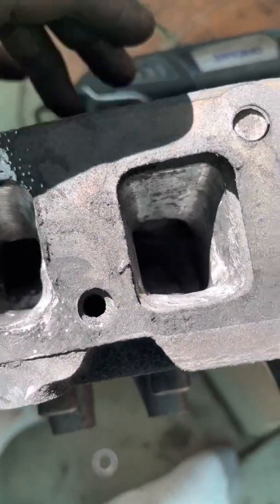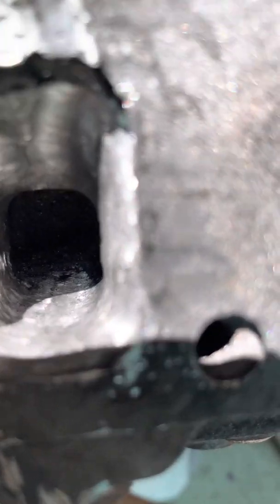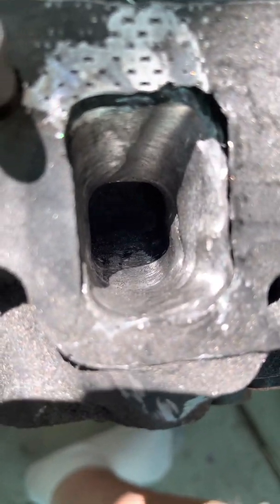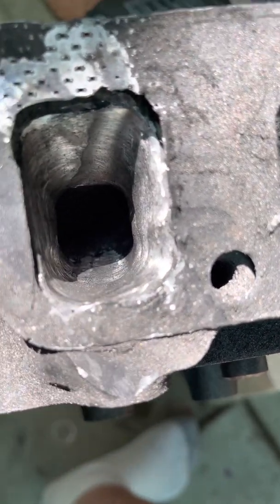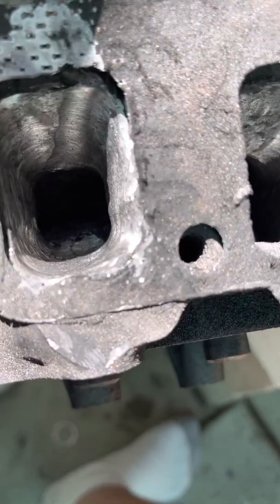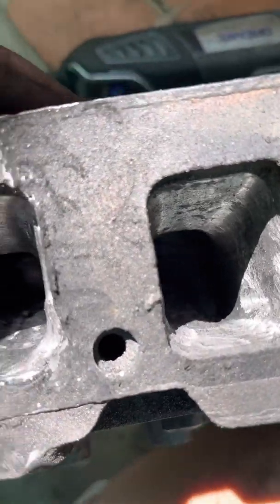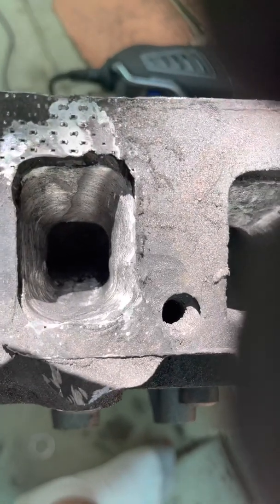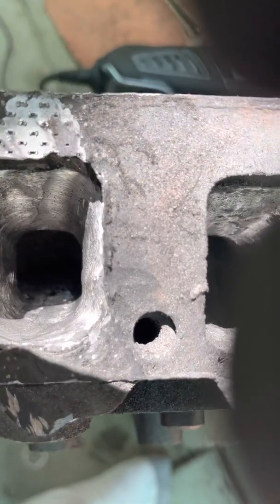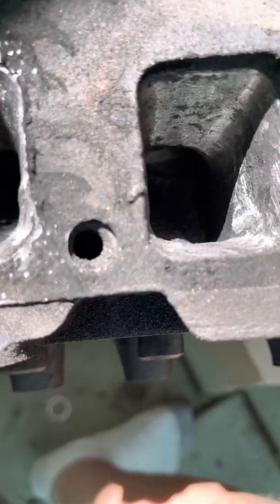It has a throat, sort of a circular throat, and then it funnels outward to a rectangle. That's the kind of thing the Hoover Dam uses on their turbine outlets underwater, because the turbine outlet is below the river level. When the water comes out of the Hoover Dam turbine, you might see some surface turbulence, but the water is being put through this shape. It starts off with a narrow throat and expands, like a Harley-Davidson motorcycle's skinny vertical exhaust pipe outlet. This isn't as severe as that, but it should improve the flow.